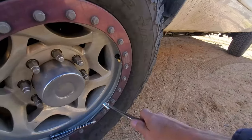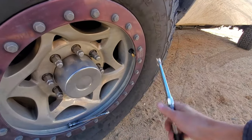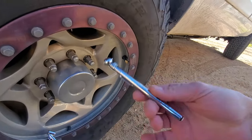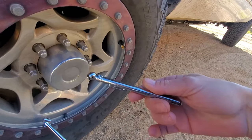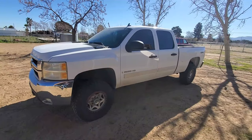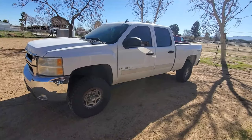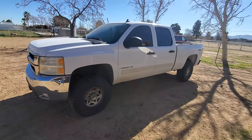Make sure you fill up your tires to the recommended tire pressure. These are aftermarket BF Goodrich KO2 tires — they're 33 inches. Because of the weight of the vehicle, we run these at 60 pounds, but don't take that number; make sure you use the recommended specs for your equipment. Whether the tire pressure monitor sensors work or not, make sure to use something else to check the tire pressure to verify that the reading on the screen is correct. If we were able to help you out with your Gen 2 or Gen 3 Chevy Silverado, please make sure to like, share, and subscribe. We actually have a few more videos coming up on this Chevy 2500 6.6 liter diesel, so make sure to subscribe to our channel. Thanks for watching.